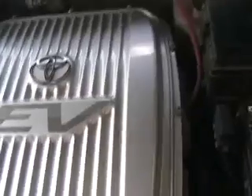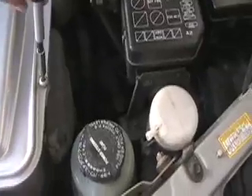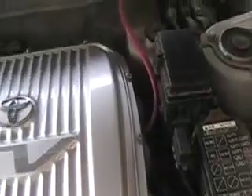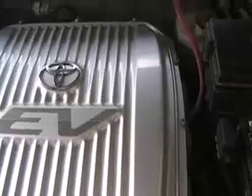This vehicle is out of warranty — Toyota only warranted it for three years or 36,000 miles. So before you go into the motor controller here in the power electronics unit, which is mostly empty space, you ought to really shut off the interconnect to make sure that the main battery pack — 288 volts nominal — is not live.